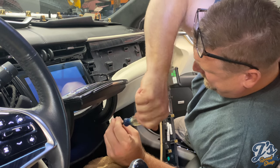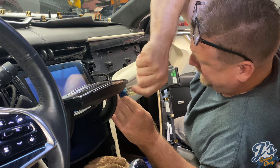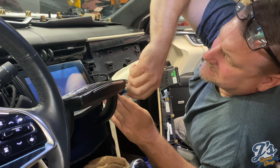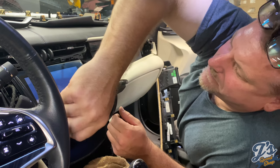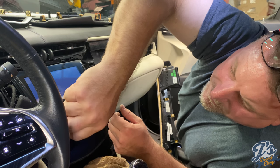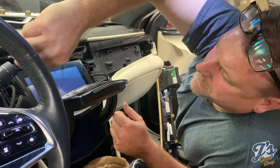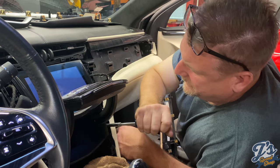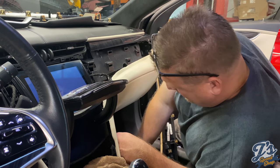It's always a good idea to have the battery disconnected when you're messing around under the dash where you could be touching wires and stuff anyway. Short something out, you learn the hard way really fast how expensive it can get. Did that in a refrigerator trying to replace something, the screwdriver slipped and I shorted two wires and blew the main board. So instead of a $50 fix, it was a $450 fix or something ridiculous. Okay, I'm gonna go disconnect the battery.